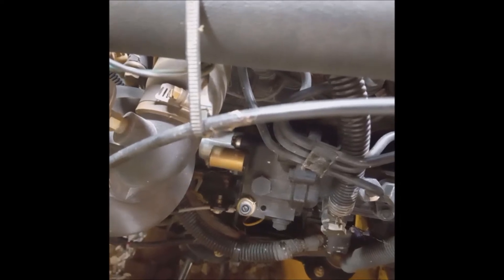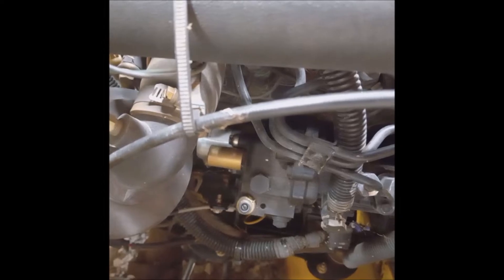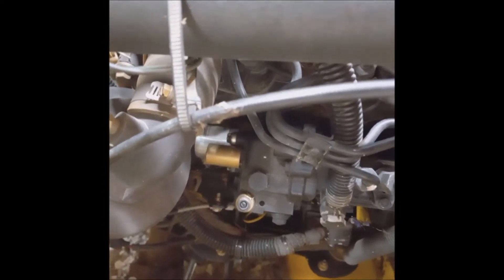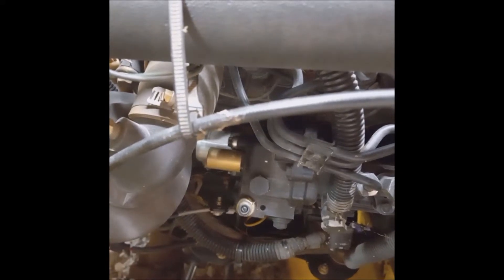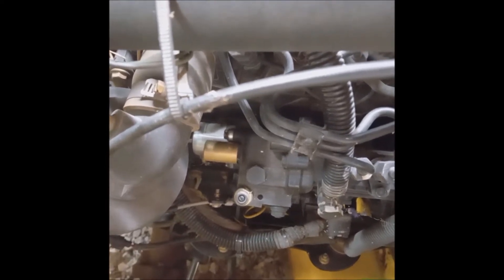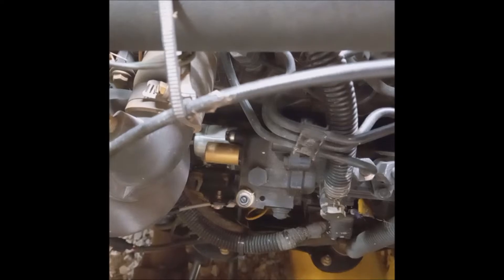The hold-in side of the coil comes from the switch in series with your seat. If you go off your seat — say you're driving along and hit a bump and bounce off — it'll kill your engine. A lot of people jumper the seat switch, and I've seen cases where the jumper was corroded; just a piece of 14-gauge wire stuck in there that wasn't allowing good current flow.